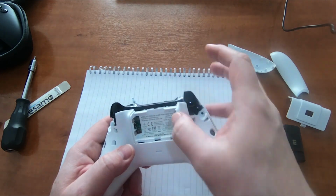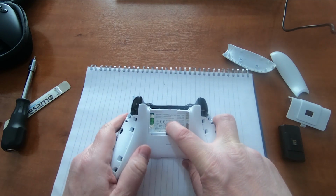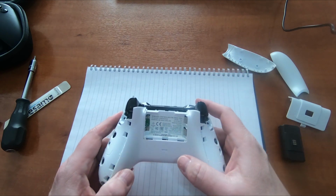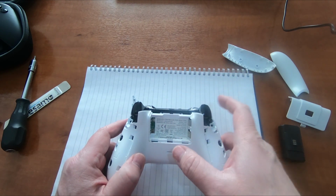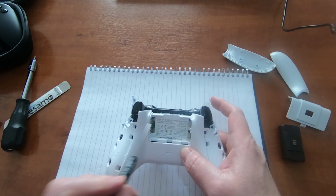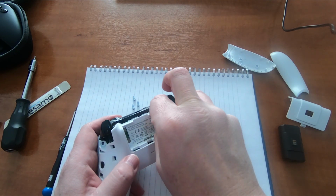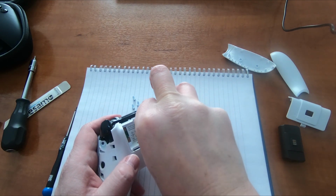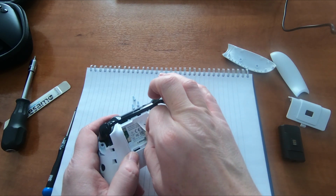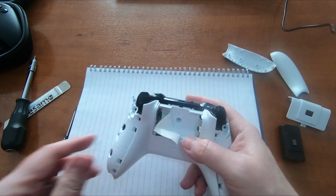Okay, there's also a screw, I feel it under there. There's a screw under the sticker. It's been done like that for warranty purposes I guess, so you can tell if it's been into it. Now you can just poke a hole in this plastic, take a piece of plastic out and the screw will be visible underneath, or if you want to keep the label, you should be able to just peel this off. It's a plastic label so it's not going to tear with any luck. Okay, just peel that back enough where you can get to the screw.